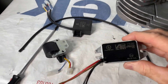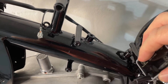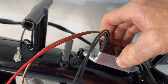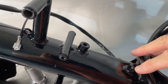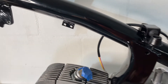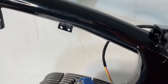For the regulator, I think I'm going to end up making a bracket and mounting it around this area here. I will need to clean off all this powder coating — I have to make sure it has a clean area for a ground and gets grounded well. Also up here where the coil will go, I need to make sure that's cleaned off and has a good ground.